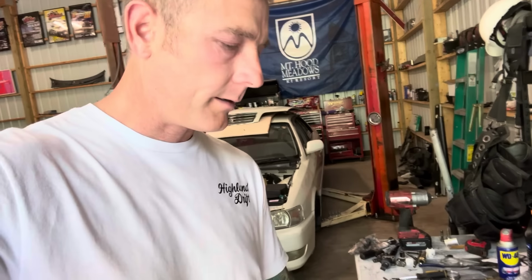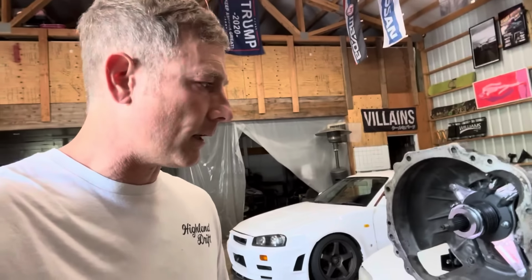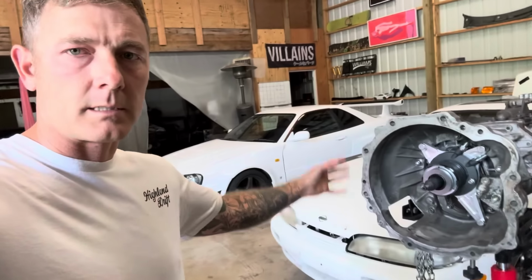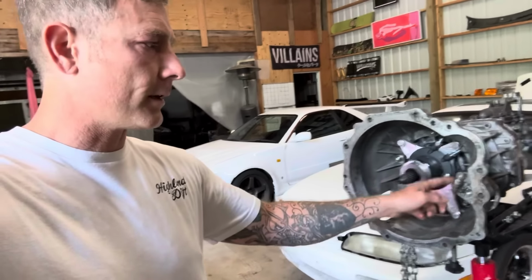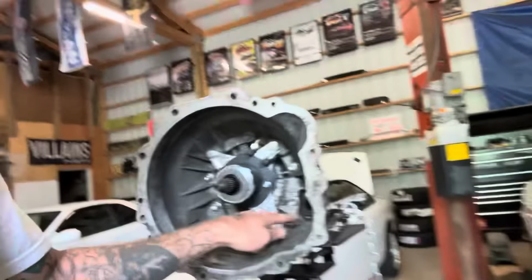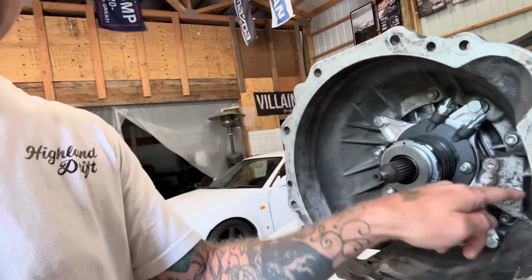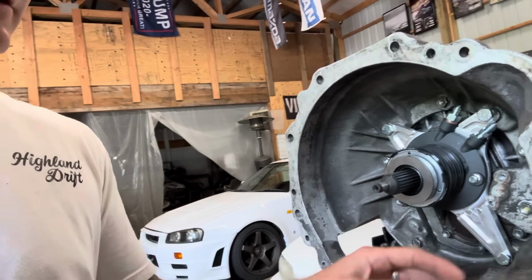They also stock the AC delete belt, so I got that. And they have the transmission lines all done. The way I'm gonna run the lines, since the exhaust is on this side, I'm gonna run the lines through this hole where the old slave was. That way they'll tuck nicely away from the moving clutch parts.